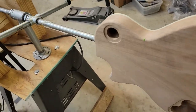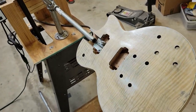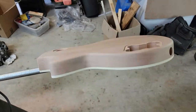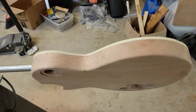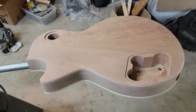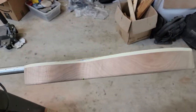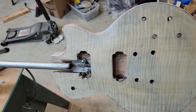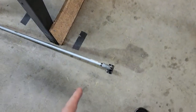You turn the power on full and it just turns. If you lay on some thick lacquer like Brighttone Crystal Lac, that takes a little longer to cure than say 2K clear. This evens it out and works out really well.